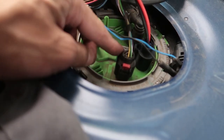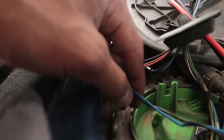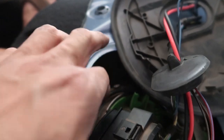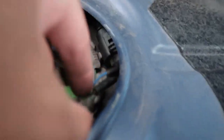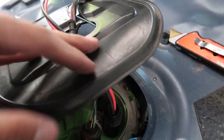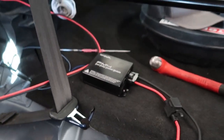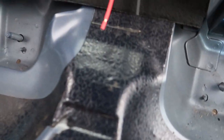This connector with the red tab stays — boom, this is your new power. We cut a hole in the grommet, ran it through, and it'll run up to the battery. The thin brain wires are connected and shoved back into the spot where the stock fuel controller was — seems like it'll stay decently tight without banging around. I took the other connector with the false cap and tucked it down in there; might throw a zip tie on it so it doesn't rattle. I'm just going to mount the module right there for now with some velcro.